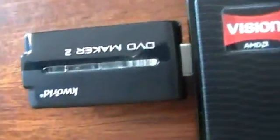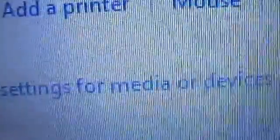Once you've installed all the drivers, you need to double-check that the capture card is actually installed correctly. Bring up the Control Panel, go to Hardware and Sound, then go right to the top where Devices and Printers are, and come all the way to the end — mine is Device Manager right at the end. Click on that.